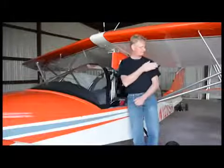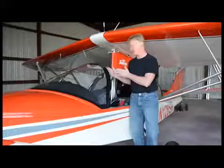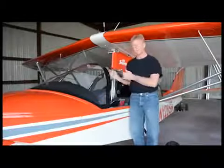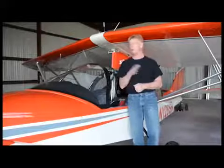90 degrees and physically look at the left gear being right there, and physically turn 180 degrees and look at that right landing gear right over there as well. Don't rely on switch position or 2 lights to indicate what the gear is actually doing. You need to physically turn your neck 90 and 180 degrees and visually identify that your wheels are physically up.